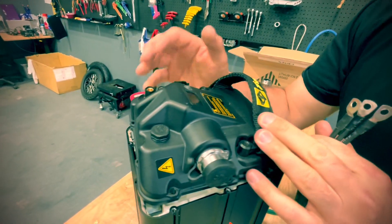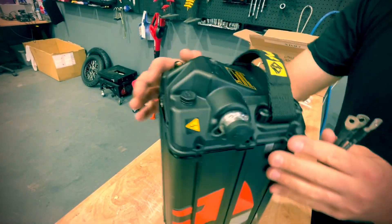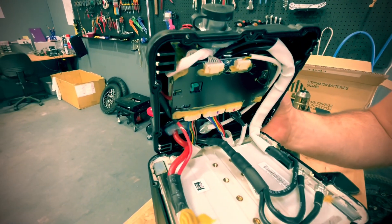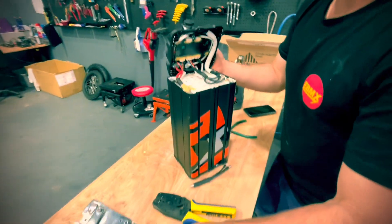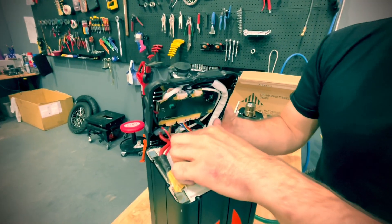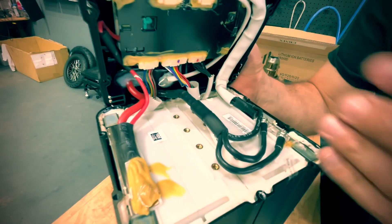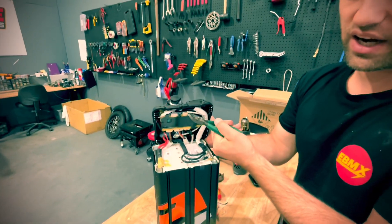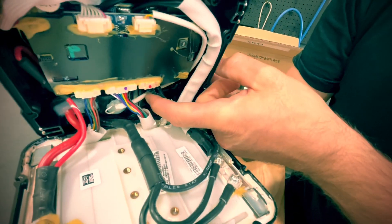Because the main discharge connector — this one here — if you flip the battery the old way, the connector will be up here, so all the connections are done up here. It was a lot easier to crimp connectors, even use a large crimper like this. Now this wire is a very small wire that goes all the way to the back here, so it's kind of hard to access. What you want to do is get a side cutter like this and just go and cut there. Be careful not to cut any wire in the back.